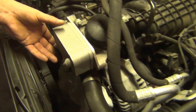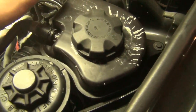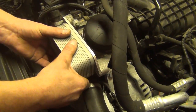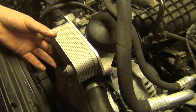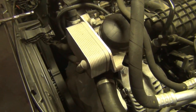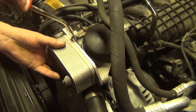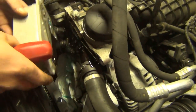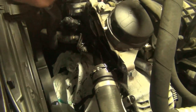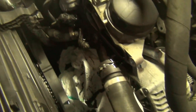You're going to lose a little bit of coolant — make sure you've depressurized the cooling system by opening up the cap. Preferably this is done on a cold engine, not a hot engine. Then put the cap back on, which is going to hold in some of the coolant from just pouring out. You can see that the plastic is actually working really well so that it's not going to drip down onto your belts.